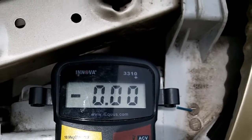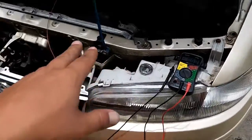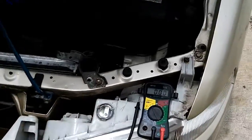I'm going to use the hood latch as the negative. We're getting zero — so that's good. Now we're going to start the car and run it. It doesn't have to warm up, you just have to idle. So you don't have to wait long for this test. You just turn the car on, let it idle for a couple seconds, and then come and check this.